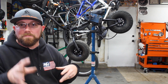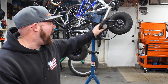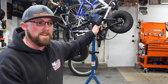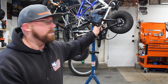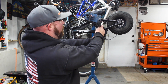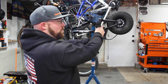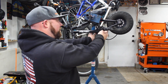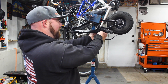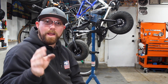How do you tell if your bottom bracket might need to be readjusted? Put your pedals at 12 and 6, grab onto your crank arms — they should be nice and sturdy. In my case, there is a small amount of play and I can actually see the crank arms moving. Some are far worse than others; in this case not super bad, but that means you need to readjust it at the bare minimum.